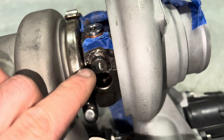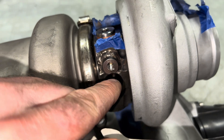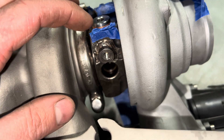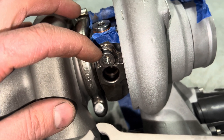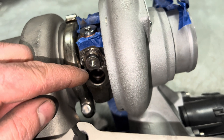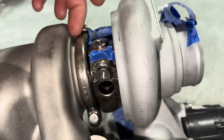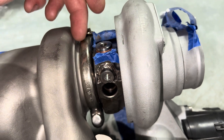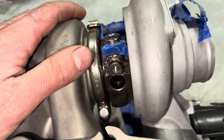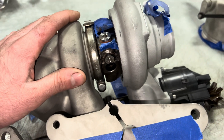I had other issues too. I was getting my employee to tap this hole, and he pushed or forced the tap too hard — the tap broke off in there. Usually I can punch the tap to try to get it to break, but this tap wasn't breaking. We ended up breaking the side of the bearing housing where the rear seal goes into, so we had to sleeve the back of the rear seal on this bearing housing as well. This was a total disaster, but we got it all fixed now.